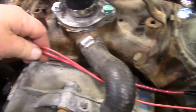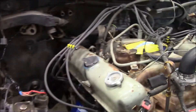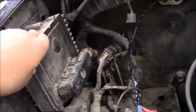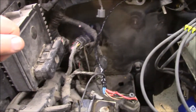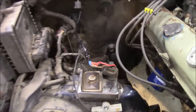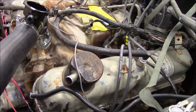When we're all done, we're going to tidy up all this wiring — it'll have black tape on it and we'll eliminate all wiring we don't need. But you've got to be really careful when doing something like this. If you want to make it streetable, for example, this is your transmission controller from the original 45 RFE transmission. Sometimes you'll eliminate some wiring and something totally unrelated that you don't realize may not work — for example, you may eliminate this wiring and your turn signals may not work. So you've got to be very cautious about that. We want to at least make it streetable so we can take it to local car cruises and maybe venture down the old 660 someday.